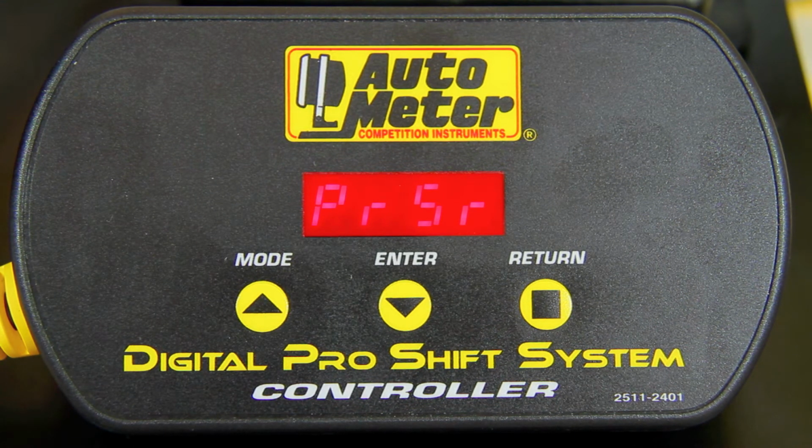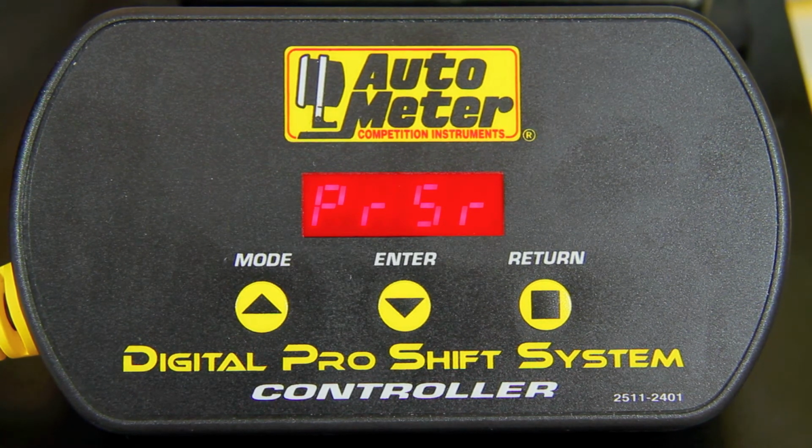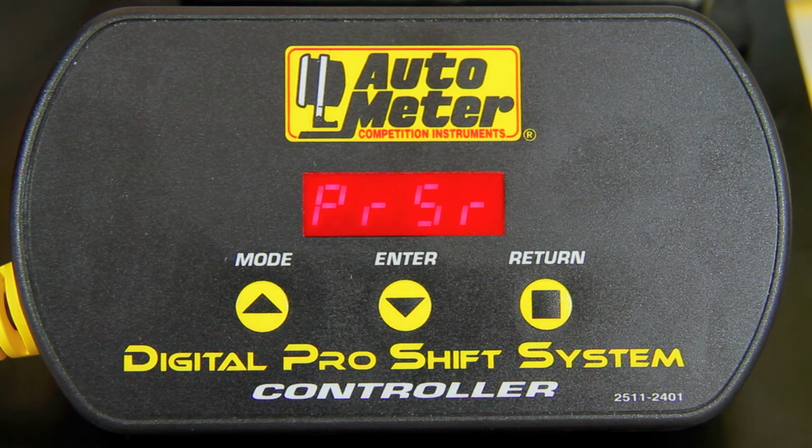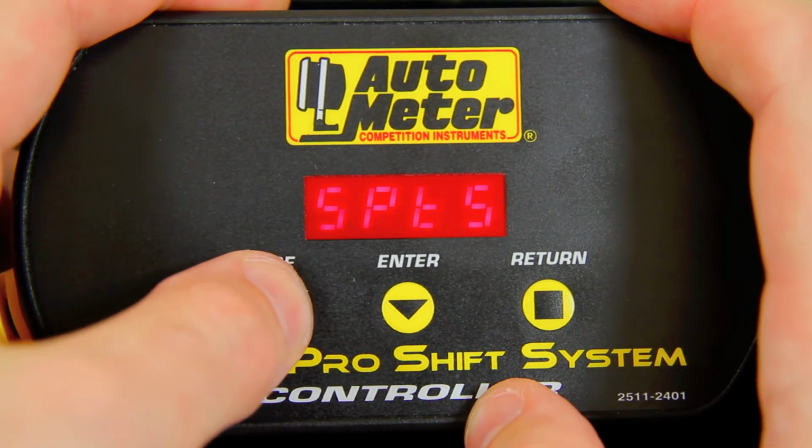Now we've got a 5 mile an hour window that can be taken advantage of. This technically, using the same formula, gives us up to 4,920 RPM without incurring a penalty. We will now configure our red band to give us 1 lit indicator for every mile an hour above pit road speed using the bands function, which is abbreviated as BNDS.